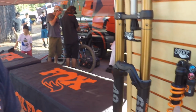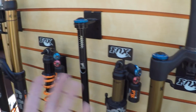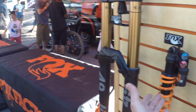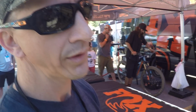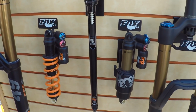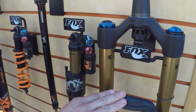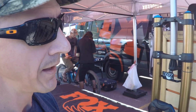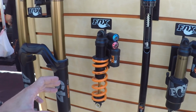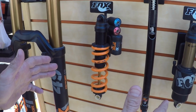I've heard something about springs being like, if you're hitting this a lot and the air heats up or it changes the ride or something, why would you go with the spring ever? With the rear shock, you've got leverage on it where the shock may only move 2 inches, but your rear wheel moves 4. Right. So this is doing twice the work as what a 1-to-1 fork would do, where it moves 1 inch on the wheel, 1 inch at the fork. Yeah. So you get a little more heat that they have to handle. Okay. And a little bit rougher ride for them, basically.